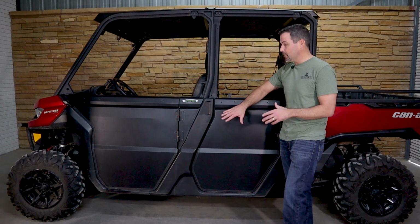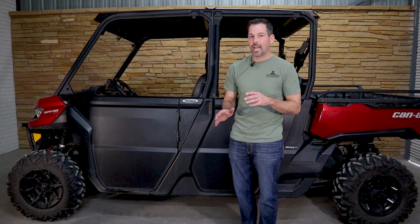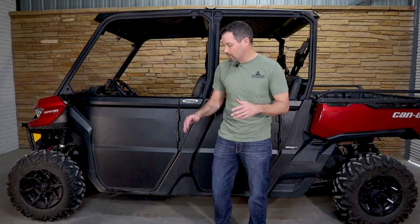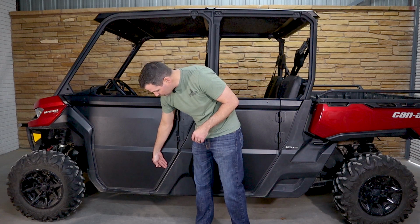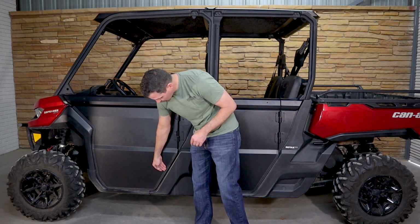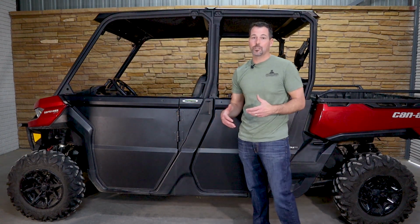On the ceiling of the unit, down around here especially, if you have any gaps between the plastic, and I'm talking small gaps, this trim has a little bit longer leg on it so that you can simply push that out down towards the plastic to get the seal that you desire.